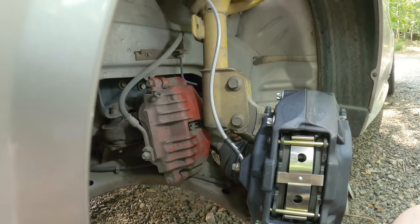Now we're putting the wheel back on — and by the way, that looks amazing — but look at the clearance. It's way tight. It's not touching as best I can tell, but it is very, very close. Just be aware these calipers are big and a lot of wheels will not clear them at all. These are 18s and we have plenty of room diameter-wise, but just where they sit so far forward. I'm probably going to get a tiny spacer just to give it a little more room.